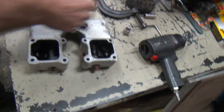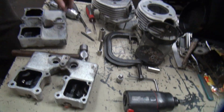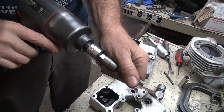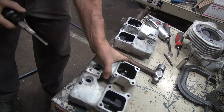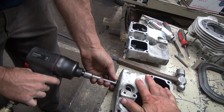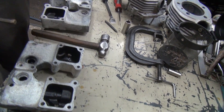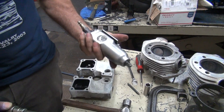One trick we do: tighten it tightly. We used a half-inch gun because it has more shock. We have to use an adapter to go down to a 3/8ths. Half the times that will pull it, whereas the little small one doesn't have enough hit to do it. Because this has a lot bigger hammer in it than that little small torque.